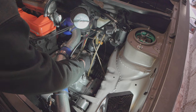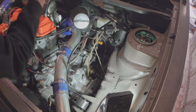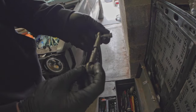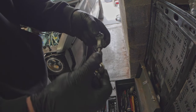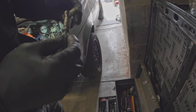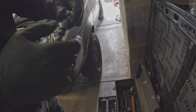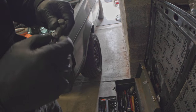The other thing is this rotational motion really comes from moving the shifter side to side, and that is directly correlated to the u-joint that's under the shifter. I'm going to look at that too. This is pretty much what those heim joints look like — they let each end pivot, so it just acts as a link and allows some movement. This one side was just a bit loose — it didn't have its nut attached, so it could do this little wiggle motion, but it couldn't come off. So that's not our problem, but I am going to tighten it up and put it back on.